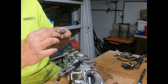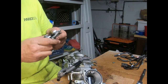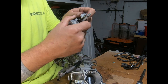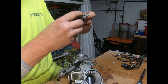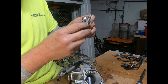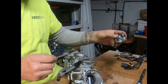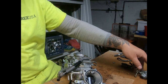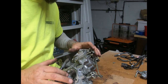Alright, we got our accelerator pump. See? Nothing's happening with it. It just all broke loose and that's what we need to see - it has to have some action to it, you can hear it. We need to see that it's got some movement. But this definitely had some bad gas just sitting in there, because you can feel it all cracking loose every so often on a little part or two. We're going to roast it out.